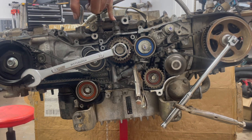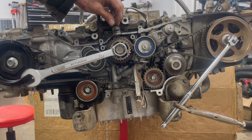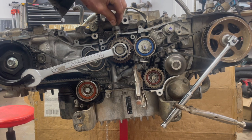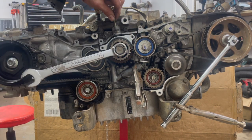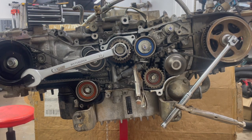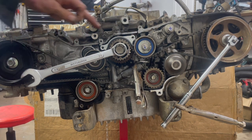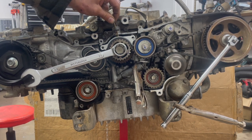You see this bolt right here? There's a crankshaft position sensor in here. You take this bolt out — it's just a little 10mm bolt — and poke a nail in the hole like that, then push it back and forth. You can feel that that's rubber. And if it had the guard in there, it would contact steel, and that feels significantly different than the rubber, so you'll know. I have an EJ-25 that I bought from Small Car, and I took this bolt out and I can definitely feel steel in there, so I know it's got a guard.